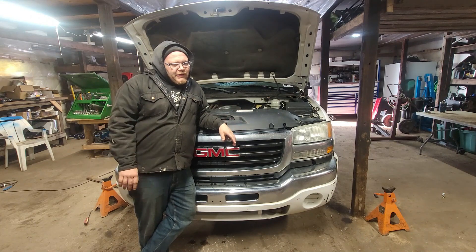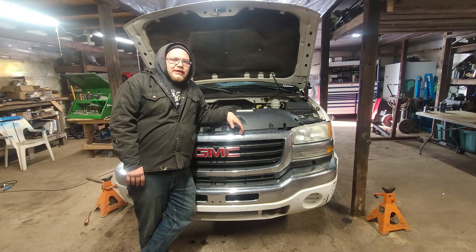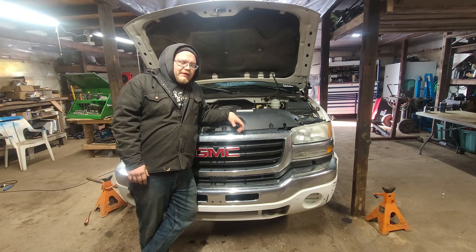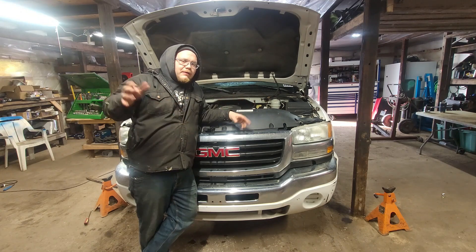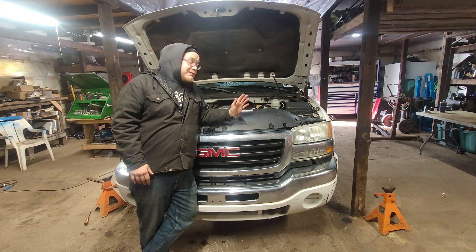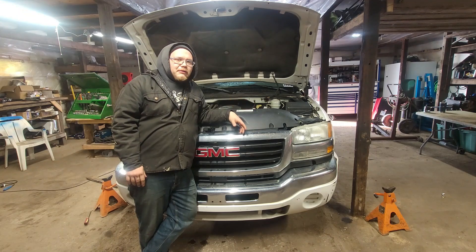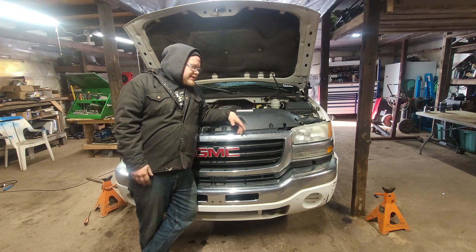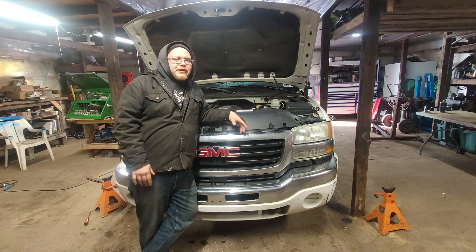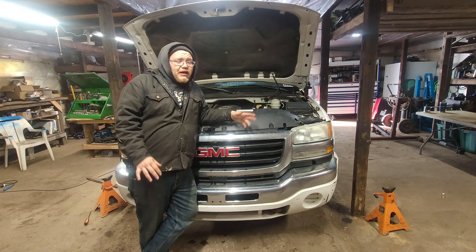Step number one here is already fairly controversial. We're going to dump a couple liters of diesel in this. Maybe we'll get it warm first, but either way we're going to have a couple liters of diesel in the crankcase and just run it. Hopefully that'll make some of the crunchy, dirty, gross, slobbery bits that I'm guessing are in this engine go to the bottom, and it'll make our end cleanup a little bit better. Since we're hopefully not going to send it to a machine shop, we don't have to worry as much about oil passages being dirty. At least that's the theory — I don't recommend the idea, it's just a thing I'm going to do.